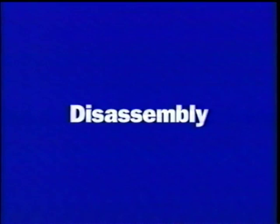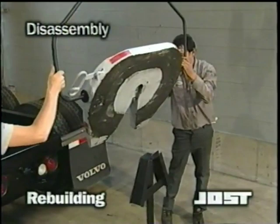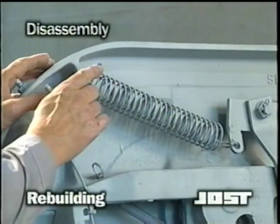All of the following steps can be done with the top plate on the vehicle. If you are removing the top plate from the vehicle, begin by using a suitable lifting device to place the top plate upside down on a table or on a stand. Close the locking mechanism, then using a suitable tool, remove the double coil spring by releasing its attachment to the fifth wheel casting lug.